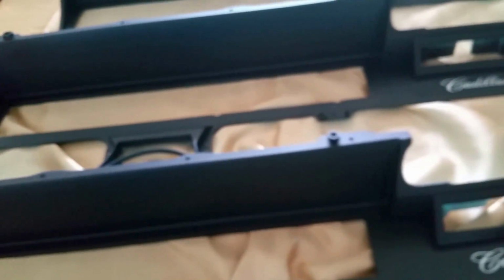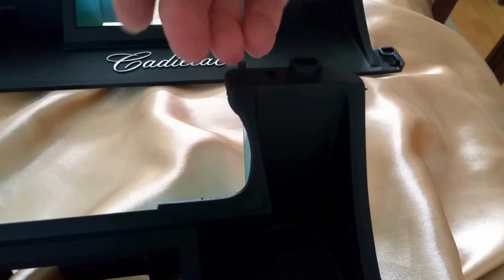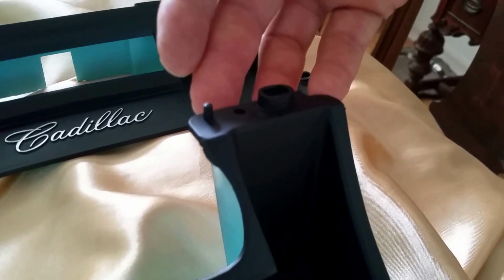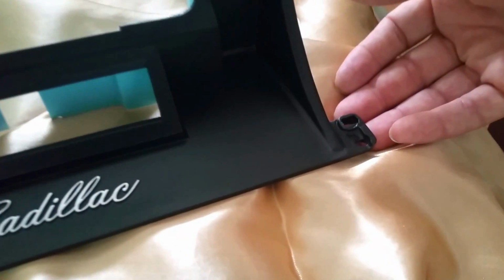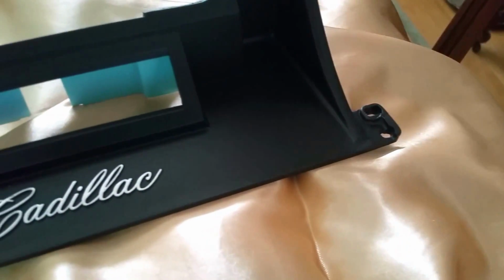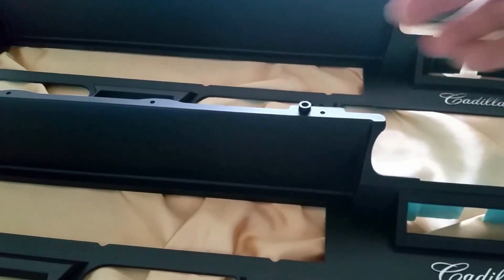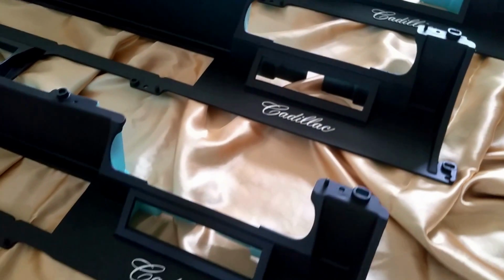Some of these areas include these complete tipped areas. So I would make complete silicone rubber molds and recreate many of these. Some of the units were broken on the end tabs, missing and shattered. Other ones had top tabs missing and shattered. Other ones were split down the middle. And in all the cases, each of these had to be repaired.